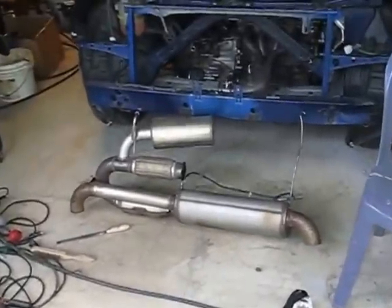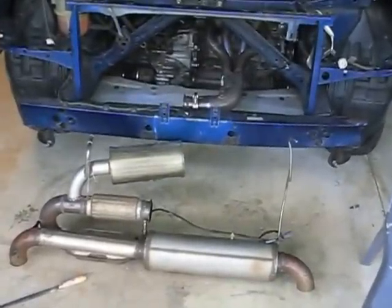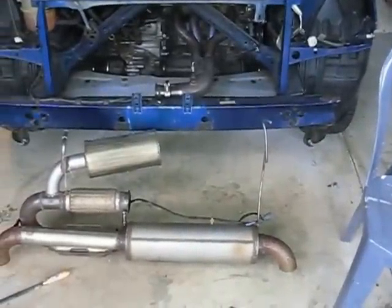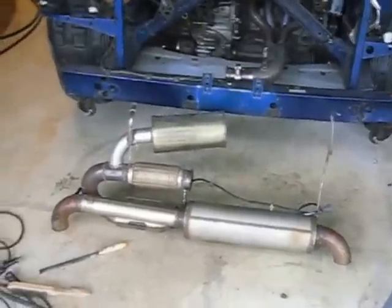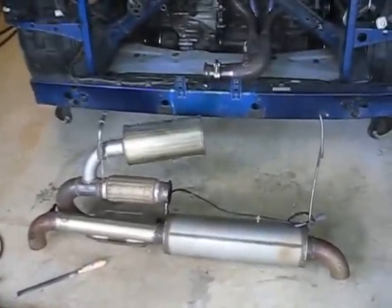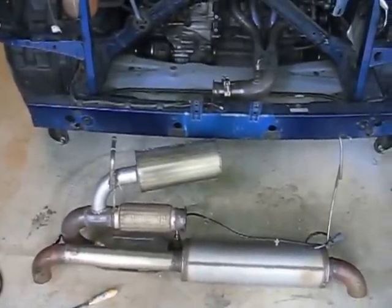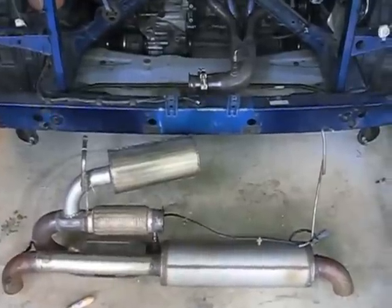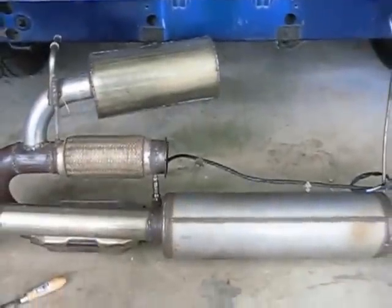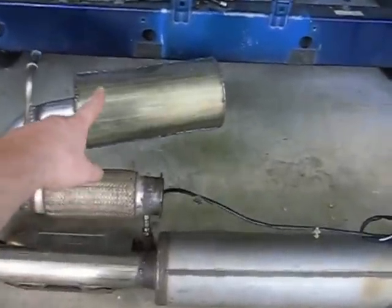This is my attempt to get rid of a horrible drone at 95 to 100 Hz, up to 110 sometimes depending on RPM, as well as 210-220 Hz — kind of hard to tell with the logarithmic frequency scale. I don't know if the 200-ish is a harmonic of the 100-ish, or if the 200-ish is causing something else to resonate at a half frequency, but I'm going with the assumption that the 200 is a harmonic of the 100-ish.